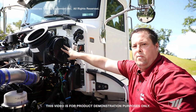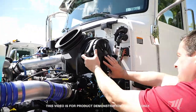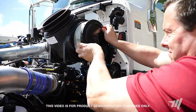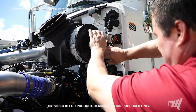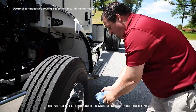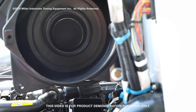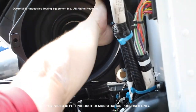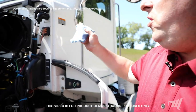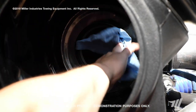The first step is to take off the fasteners from your cover and place your cover out of the way. Pull your air filter element out — it may be a little tricky with some of your wiring. Get a damp rag, remember to wring out any excess water. All we want to do here is clean out any dust or debris that may have fallen into the housing from the old filter element.